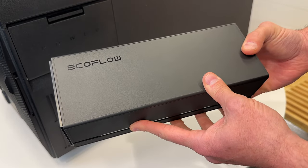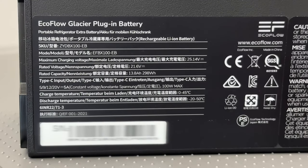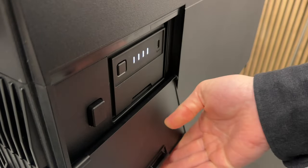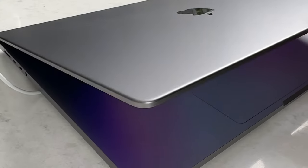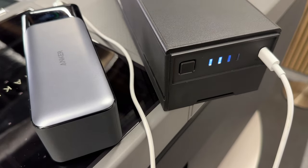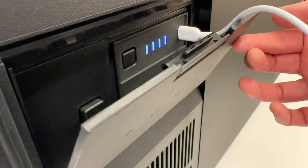The third way to power it is through its internal 298 watt-hour battery pack, which uses NCM chemistry rated at 800 cycles and weighs 4.2 pounds. I think they went with NCM chemistry because of the weight and size constraints, but I really would have preferred LFP. The battery slides into a compartment on the back behind a door, with a four-level LED indicator plus an on-screen percentage readout. You can also pop the battery out and use it as a battery bank with its 100-watt bidirectional USB-C port to charge laptops, tablets, phones, or drones.